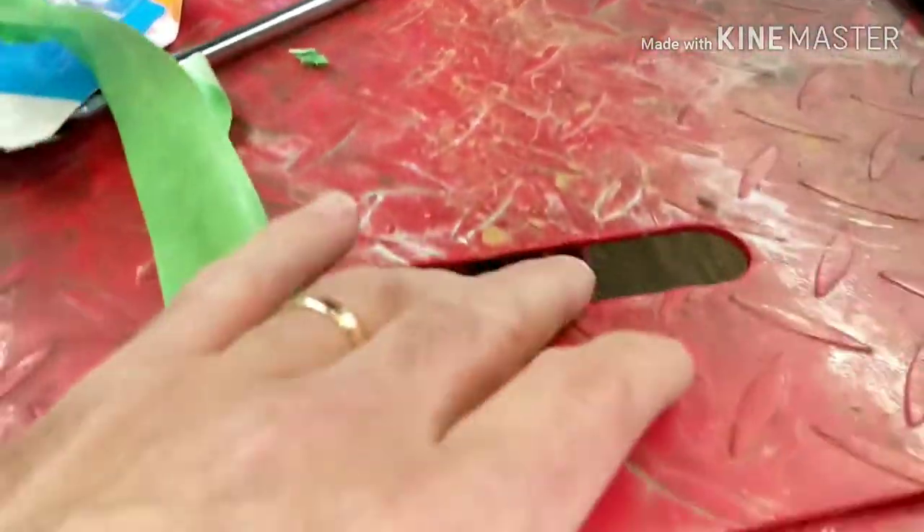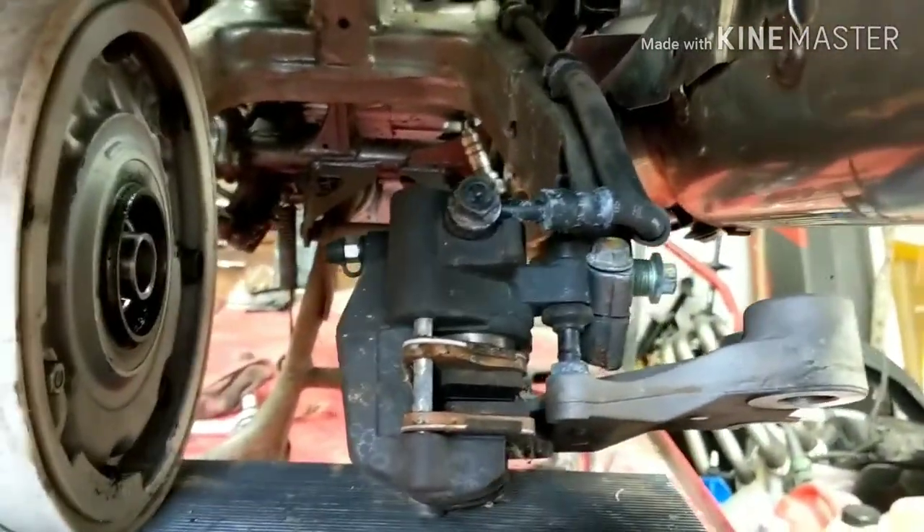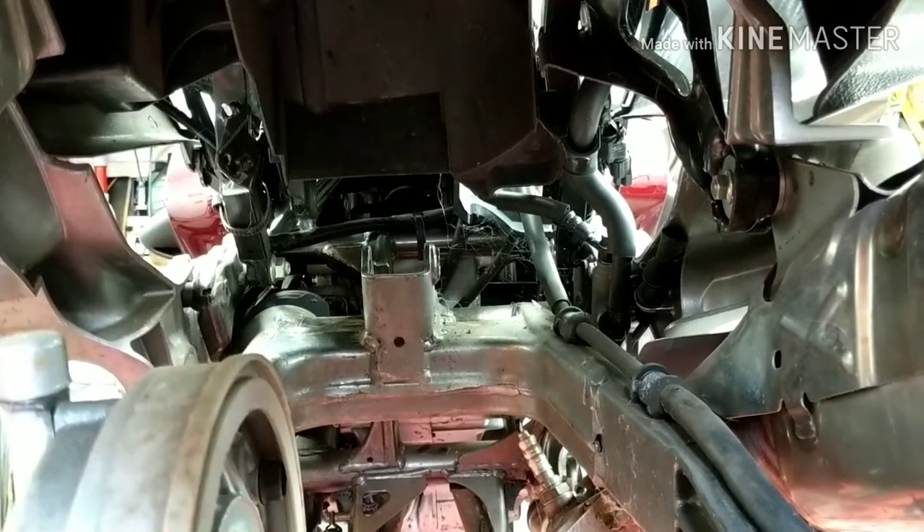So we got the shock out. Basically what I did here is I was able to leave the bags and everything on. I have a lift here that I can pull this section out and drop the tire and the wheel and everything goes straight through the lift. Then just wiggling everything around up there. Here's the rear brake caliper and the bracket — you're able to just move that stuff up out of the way and then get the wheel kind of wheeled out. So that's out of there. You can see where the shock was mounted right here, and the other one is up top.